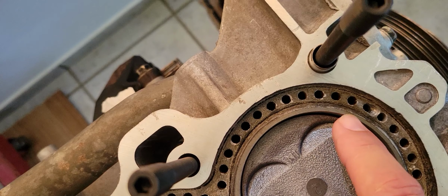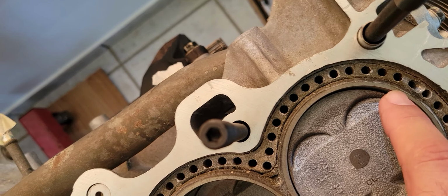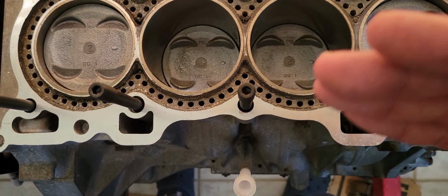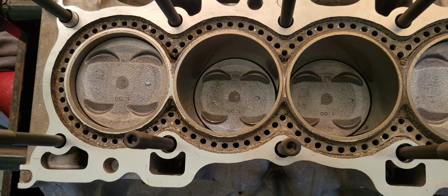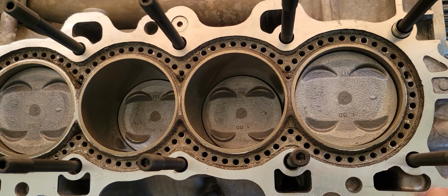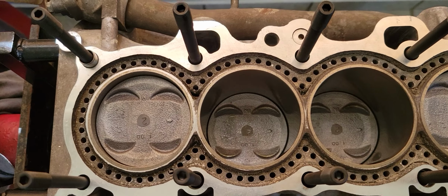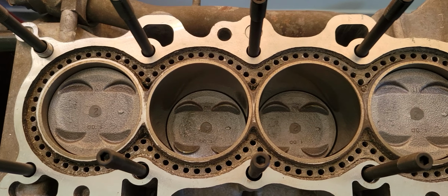Here you can see it's on the sleeve. It's kind of no aluminum left. So the front side of the engine, the one that goes to the exhaust, is the most corroded. Most likely, maybe because it's the hotter side. So the activation of corrosion and minerals and all that dirty water grinding the aluminum may have been bigger.